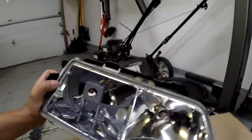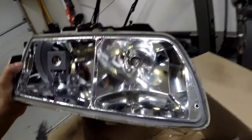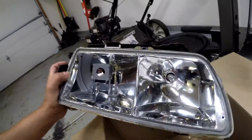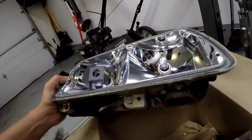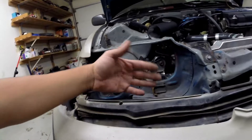So there it is, all taken apart. Just got to take the headlights out, take some of the stuff internally out — here's the broken glass in a box. Got to disassemble everything and try to paint the housing black and the inside of the reflector area black as well. Here's the stock headlight — I had to remove the bumper partially, the upper portion, and the actual bumper support beam crash beam, to be able to sneak it out since it sits pretty tucked in there.